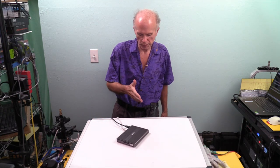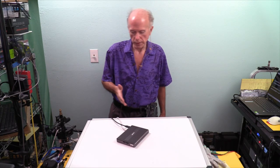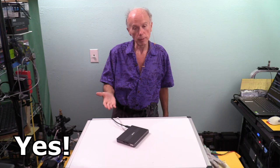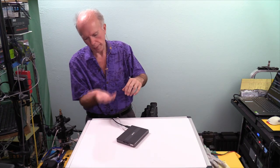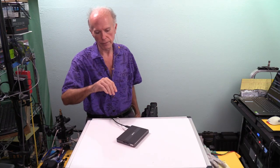I should have tested it on USB-C but this is specified as a Thunderbolt device. I know we'd have reduced speed — I don't need to test for that, we're looking at maximum performance. I would use this to transport data; I don't know that I would use this as a working drive. The problems in the beginning with the connection were more about my patience. The device heat: I can touch it — too hot for baby's milk, but fine with the back of my wrist. The drives are on the bottom, thermal pads push heat out the bottom, but I feel heat on the top. The lights on the front stay on: one blue light for the device and four green lights — total of five, always on.